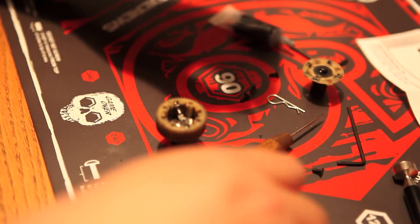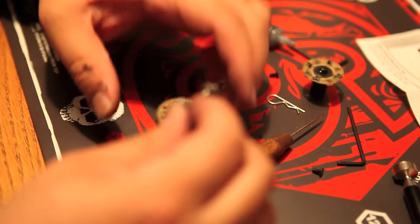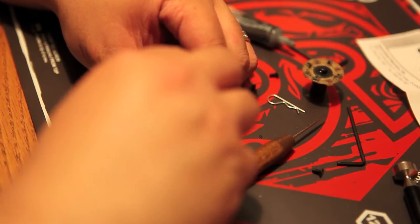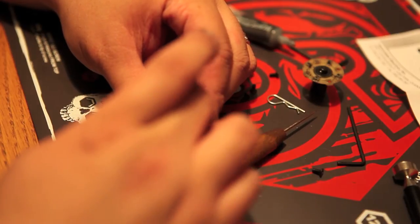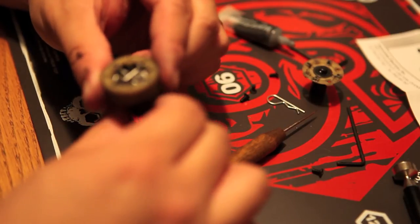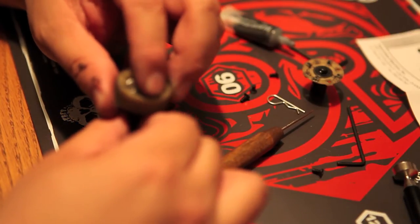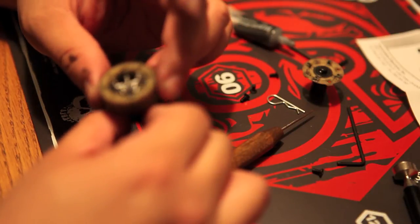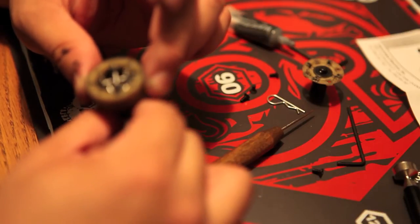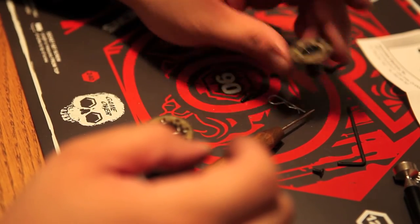If you have a lot of grease you might want to clean it off. The reason I'm cleaning it so thoroughly is that I'm going to fill it with differential fluid instead of black grease — I don't want them mixing together. I'm giving the outer rim a spin to make sure that the planet gears are moving correctly, and doing another check to make sure it's spinning up correctly.